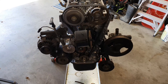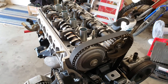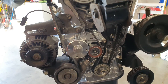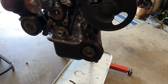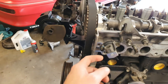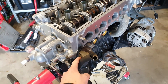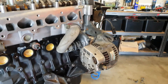Last night I've been busy just working away - didn't really video much of it - but basically just been putting all the accessories on. I've got the timing belt on, all the valve clearances are sweet now. The alternator, all these pulleys, and just about to put the cover on here and put the crank pulley on and the water pump pulley on. I've got the VVT solenoid put in - this is brand new by the way, put on not so long before I pulled the engine out. Put the thermostat housing on, put the ISCV on, and this water pipe.